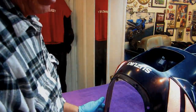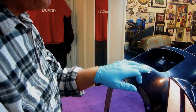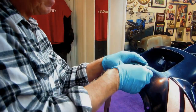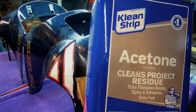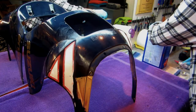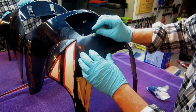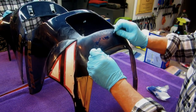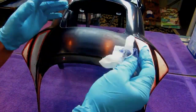On this job we were very lucky. The decals — the Suzuki lettering — were not under clear. That meant we could use a heat gun and a brand new razor to basically get them off without a lot of aggravation, and they did come right off. The next step is critical: use acetone to get whatever residue from those stickers off. I've used Goo Gone, lacquer thinner, urethane thinner, but acetone always works the best. There really was some goop under there requiring a lot of scraping, but we're going to sand the whole part anyway.